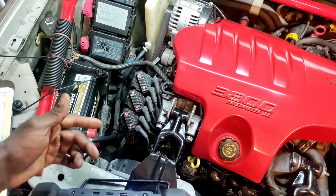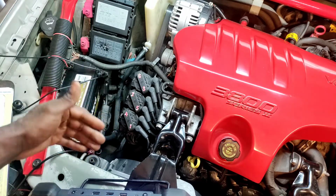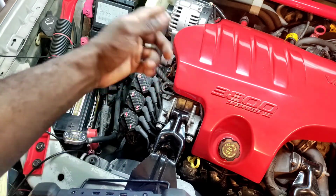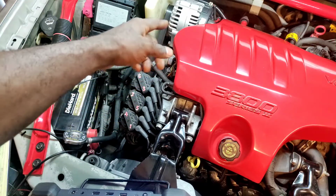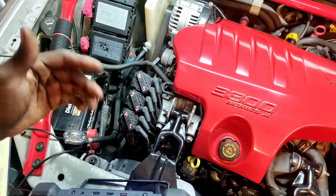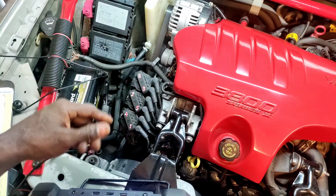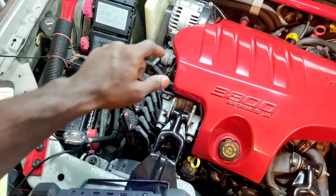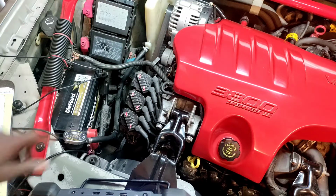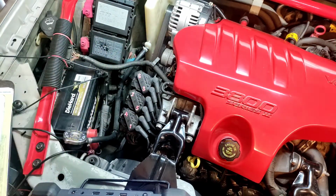So I was assuming that he thought maybe, with the alternator engaging, there were some issues with, I don't know, some electromagnetic field or some voltage generating going back into the circuit. But the alternator does feed power to the compressor, and the relay is essentially just a switch that breaks the connection. The PCM still has to ground the relay to activate the compressor, which will supply the power from the alternator. So that only supplies voltage to the AC compressor once the computer grounds the relay.